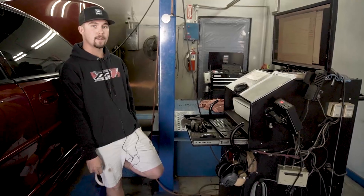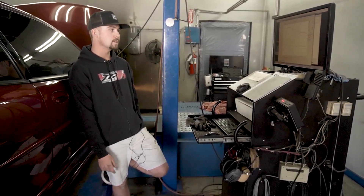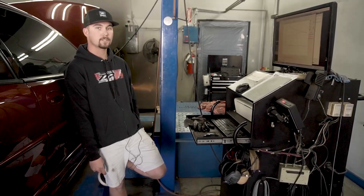Honestly, this car is out of blower. On a 2.8 it made not even 10 pounds of boost, so we had a 2.6 over here, put that on, and we were at 11 pounds of boost with a good air-fuel ratio and just shy of 20 degrees of timing. So it's got more in it. We'll see if we can get a Gen 5 on this, but other than that it did great. The curve looks great, the car is running great, and the equalizer is great.